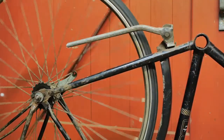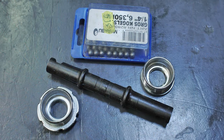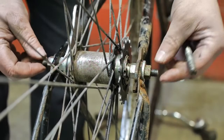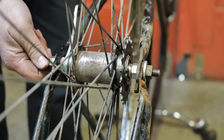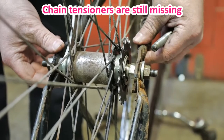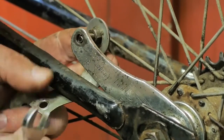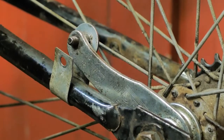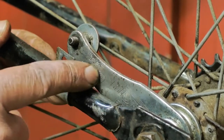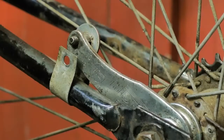So the next time in this series I'm going to reinstall the bottom bracket, and I do have the proper replacement parts for that. I don't think it was necessary to swap out the axle — there seems to be enough clearance on both sides. The brake reaction arm here is hitting the frame, so my homemade bracket doesn't fit anymore — that's another little problem that needs to be fixed, something for the next time.